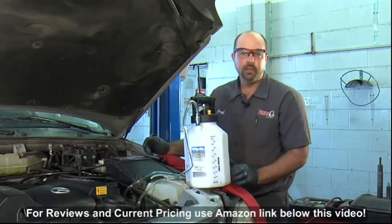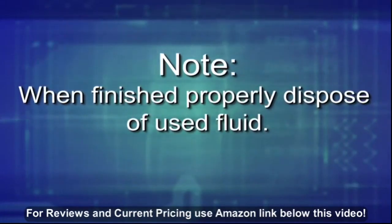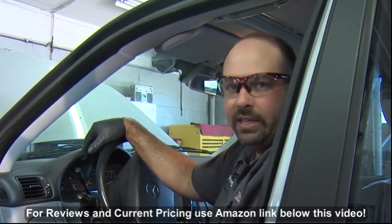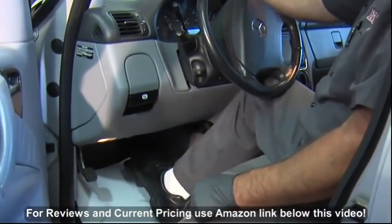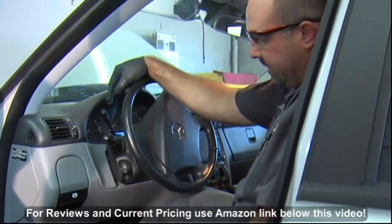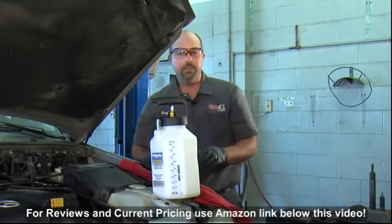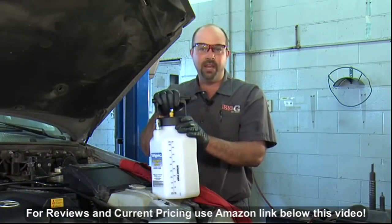Now we're going to pump up the brake pedal and make sure we don't have any leaks. Remember, when you're done bleeding your brakes, make sure you properly dispose of your used fluid. We're done bleeding the brakes at the wheels. I need to make sure we don't have any leaks, so I'm going to pump the pedal up a couple times and then hold it for a few seconds. If the pedal doesn't drop, we should be in good shape. I got a good hard pedal, so I'm going to go out to the wheel and make sure we don't have any leak at the bleeder. I just got done checking — I don't see any leaks there. Looks like it was a successful bleeding job done by the MightyVac pressure bleeder.